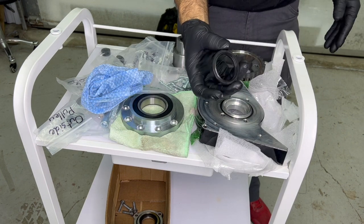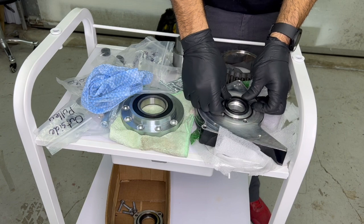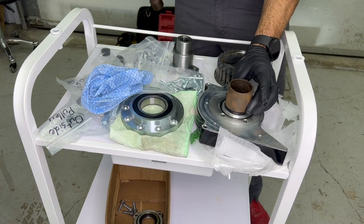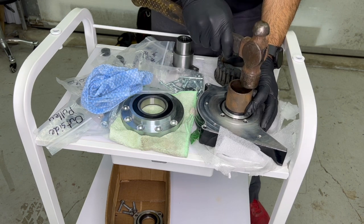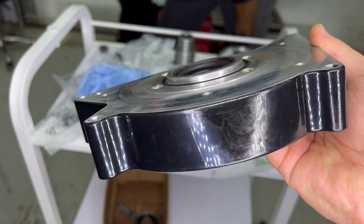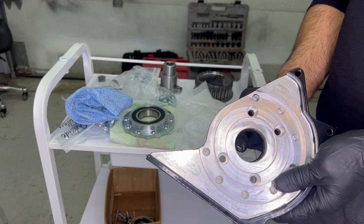Next, you're going to take this plastic cap and make sure that the groove is going upwards. And just apply it and put it on. You're going to use something that's about the same size to hit it and press it in. Okay, so use gentle taps to make sure that your seal is properly sitting all the way at the bottom. Here's a side view of how your gasket is supposed to be sitting. So it sits flush with the surroundings. With your finger, apply a little bit of oil inside your offset kit.